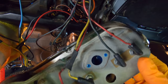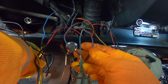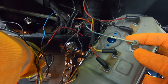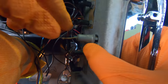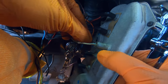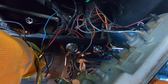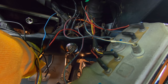That's it for gauges on the right-hand side. Now you just have a series of three bulbs. Two of these wires are blue with red tracers, and there's one that has a blue with white tracer — the blue with white is your turn signal indicator, so that goes up here in the top right. The bulbs just pop in like that. The other two are just backlights, and the placement of those you can tell naturally where they rest, but ultimately if you mix those up it wouldn't be an issue.